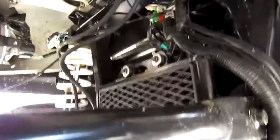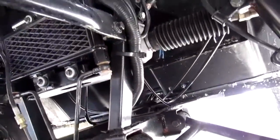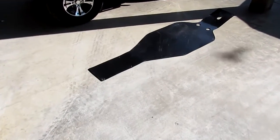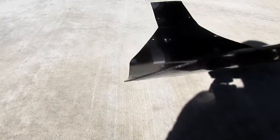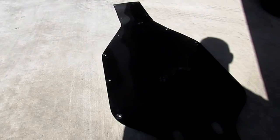When you're driving at the beach, even on a calm day it's typically windy, so you'd think it's getting enough airflow — and the designers of this machine took that into account, so it should be operating properly. But it doesn't. Up front there's an oil cooler, and its placement implies it's getting enough airflow from air slipping up underneath the machine. It was a best guess on my part as to whether we were truly getting enough airflow. We've got what I'll call a skid plate — it's pretty flimsy plastic.